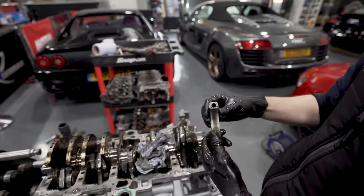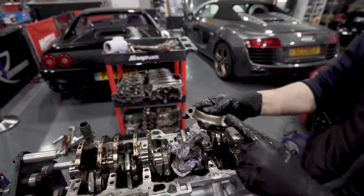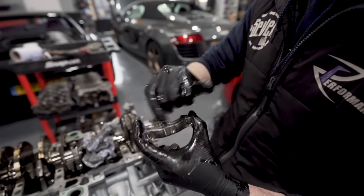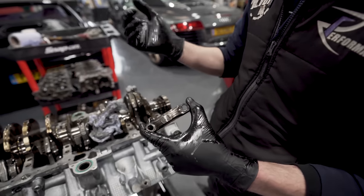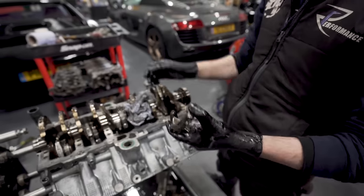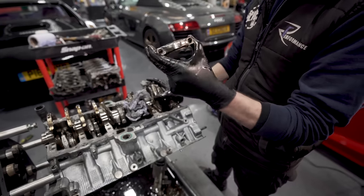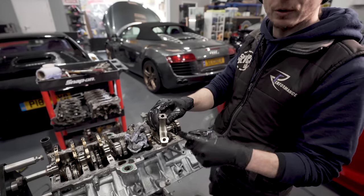I can't put that on wrong now because the rod's in right, because they're doweled. But this is something now. Manufacturers will put a mark like that, and in the assembly diagram, it would just say align marks on assembly. But CP won't tell you that, or you know who else does rods and pistons? Callies or you know Italian RP. They won't tell you that. You've got to know. And if you don't know why that is, if I give that to someone, how many people would now know? All right, we told them.